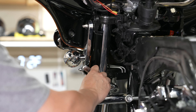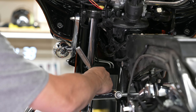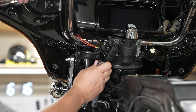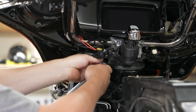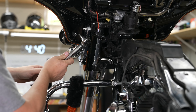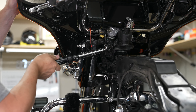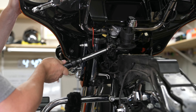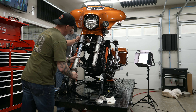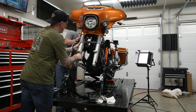With a quarter-inch hex head, there are two bolts to tighten at the mid clamp — just getting these a little bit snug first, then we'll torque them to specs. Moving up top to the one top clamp bolt, snug that one down too before torquing. Going in with the torque wrench: both the top clamp and the two mid clamp bolts get torqued to 14 to 18 foot-pounds. Then we go back in with the right fork and do everything exactly the same, getting everything lined up and torqued down.